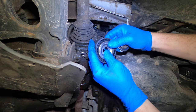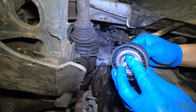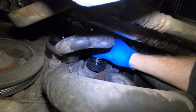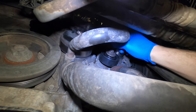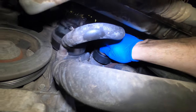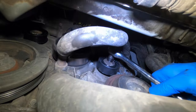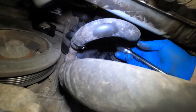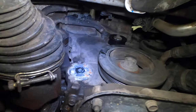These pulleys came with little silver caps to help keep moisture out — the stock ones did not have them. I'm going to leave them off because I just tried to put one on with the caps and it made a dragging noise, so those are going bye-bye. Time to do the front one. These pulleys don't have an outside or an inside — there is no marking on them. They are universal in that respect. The bolt is a tapered bolt and that's what gets it to center up into place. Two down, nice and smooth — just have the tensioner to go.